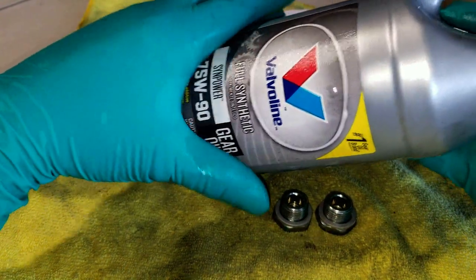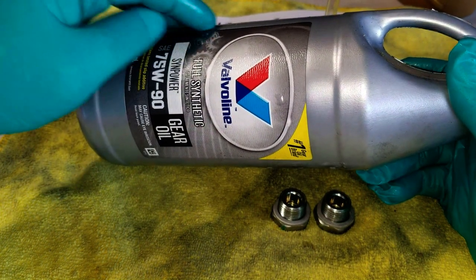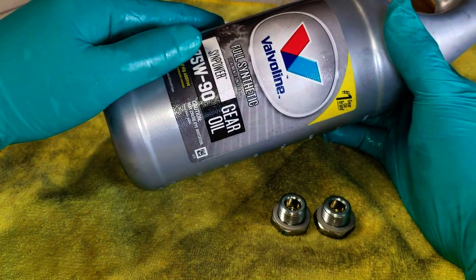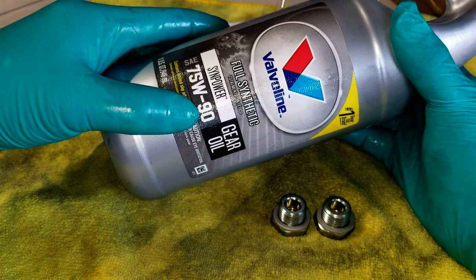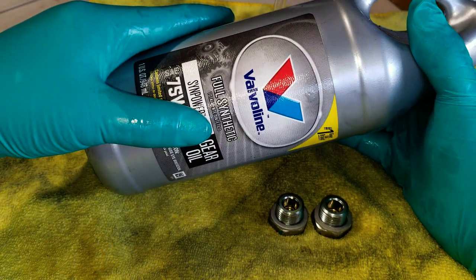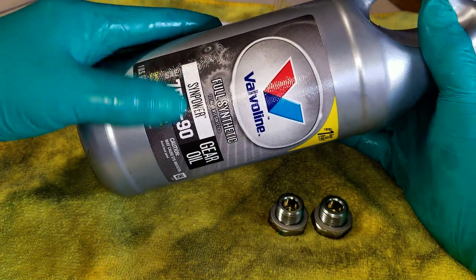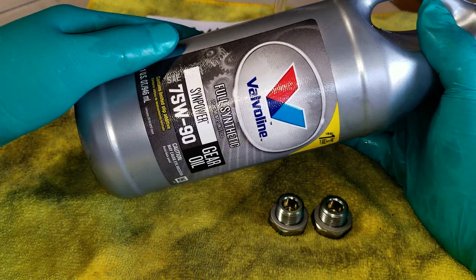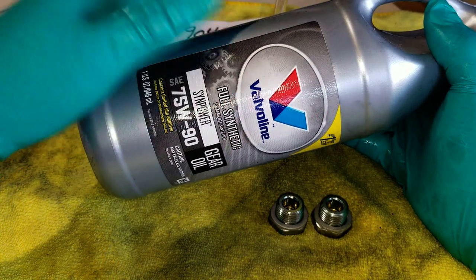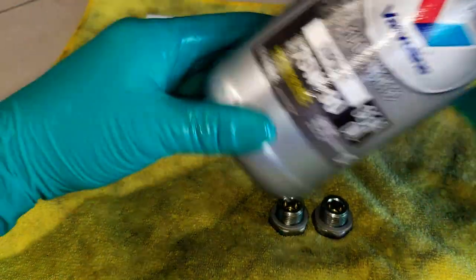I've already put the Ravenol oil inside the transfer bottle. Even if you don't clean out the old oil completely, small traces of 75w90 mixing with your 75w is not going to do anything. A lot of people on Club Lexus forums use 75w90 — they don't use the unicorn poop. If you go to Lexus dealers, they use 75w90; they use Mobil 1, they use Valvoline. So if you want to use that very expensive OEM fluid, go for it — but know that the dealer itself doesn't necessarily use it.